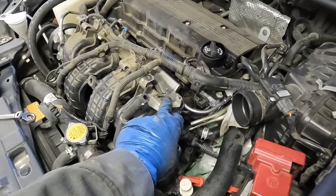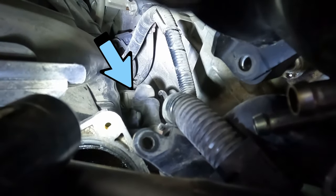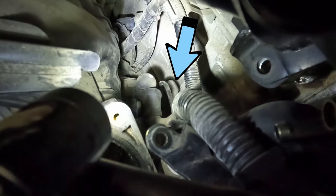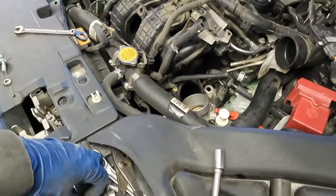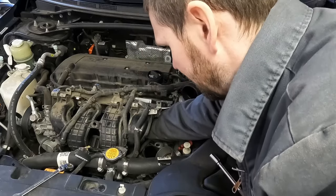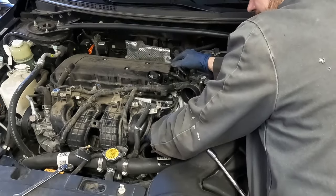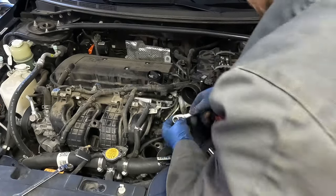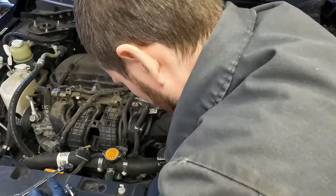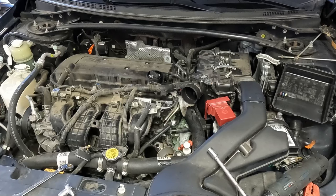This is all the farther I'm going — I'm not pulling this all the way up, just pulling it out the way I have it. We can get in right through here. Right there is our main power feed. There's a boot right there — you just pop that little boot cap off and then you have access to the S-terminal. That's that tiny wire right next to the boot. I already pulled the S-terminal off. Now I'm going to get in with a little short ratchet, 12 millimeter, and pop that off. Then we'll finish getting the starter from underneath. I'm just going to feel it — there's the boot, pull it back, put my 12 on. Got it. The starter will drop to the ground. There's the nut — that's our main power feed. Going underneath to get that starter the rest of the way out. Should be home free at this point.